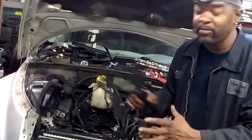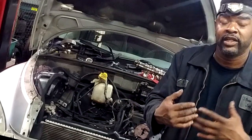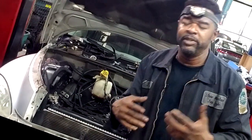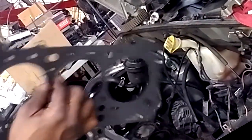I'm gonna bring the camera up to the actual block and show you what I mean when I'm talking about a multi-layer steel head gasket. Here is a brand new steel multi-layer head gasket, and this is a cylinder head that I had to send out for repairs to get straightened — it was warped. I did the cylinder flatness test and it failed.